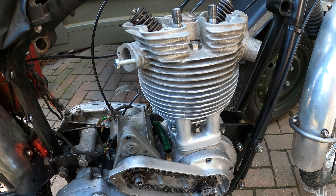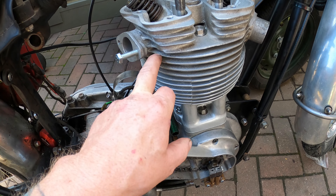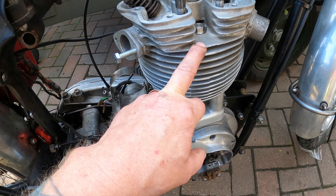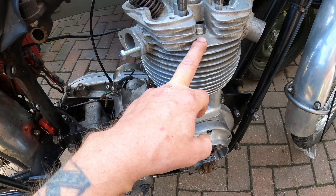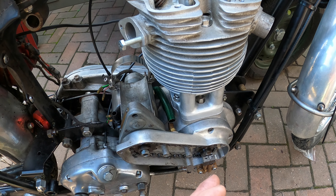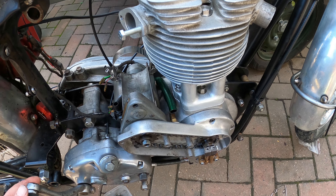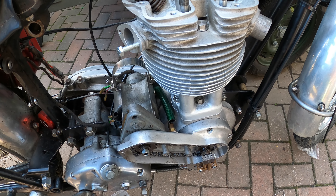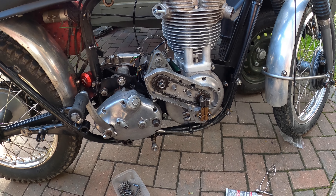When you put your piston back into the bore, a tip I was given many years ago by a chap who rebuilt speedway engines is: never oil the bore, the piston, or the rings. He said those first few revs when you first start the engine saves literally hundreds of hours of running in. The bottom end and piston wall soon get splashed from the oil you've already tipped in, so you're not doing it any harm. I heard this tip again recently from Ivan Hutton of Ivan's Shed, who does the same and has found it saves hundreds of miles of running in.